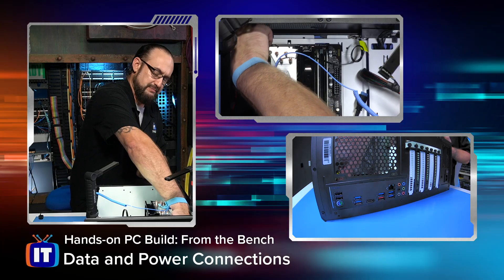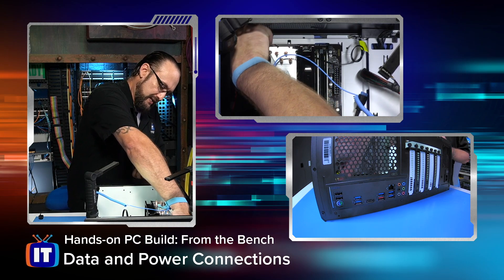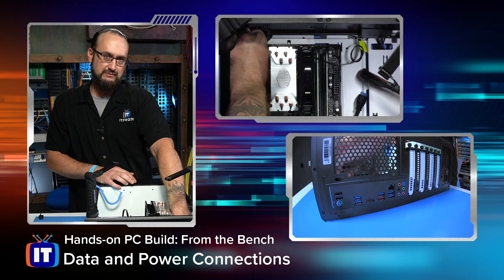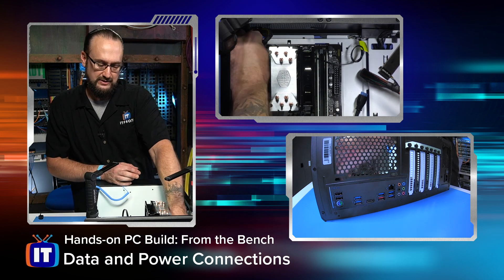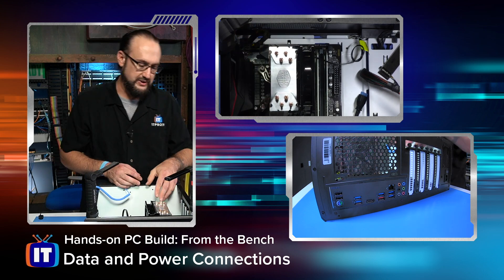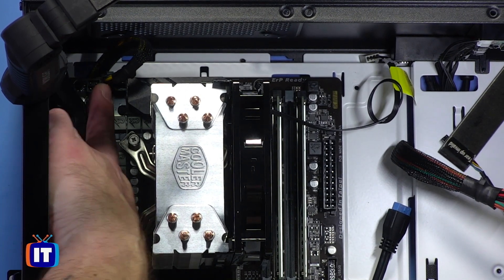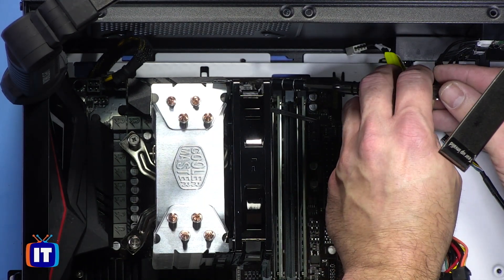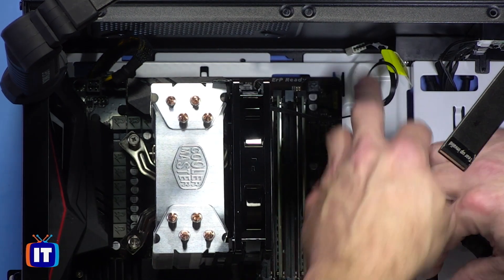There's one of them. Sometimes it can be a pain depending on how tight the cables are, because the cables coming off of the power supply can be pretty tight sometimes and give you a hard time just trying to move them. We'll try to get that connector in there — try not to put too much force. You definitely want to get a good, tight connection. We've got that connected — that is our 8-pin power connector. Moving down the line, the next one I want to connect is our CPU fan. You can probably see that it says FAN and CPU — that's actually the CPU fan.